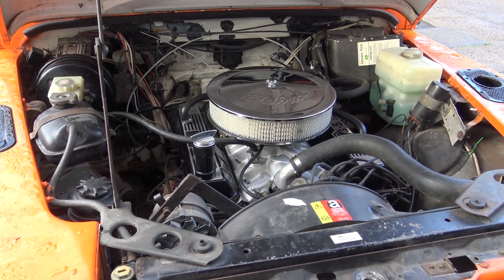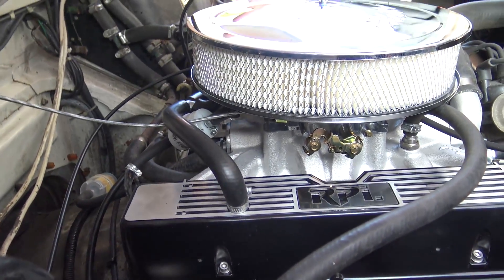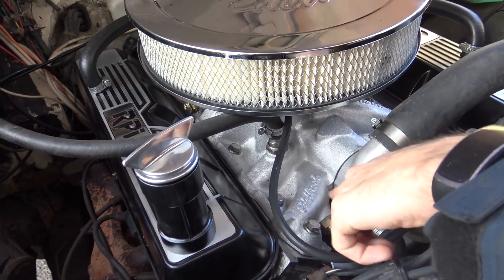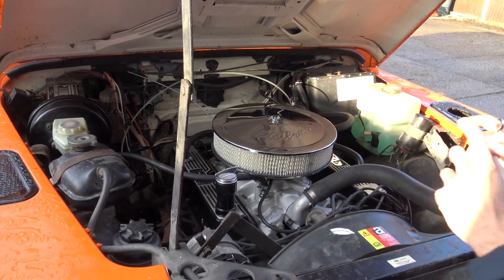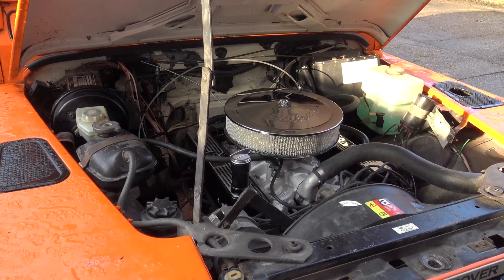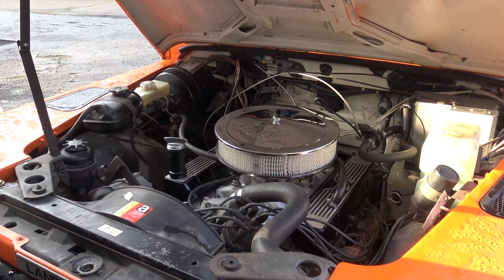Holly's finished off installing the carburettor kit. Both breather pipes from the rocker covers - which he's painted and sanded back so they're looking lovely - go back to a T-piece and into the base of the air cleaner with the little port that's supplied. The PCV valve and one-way vacuum check valve for the brake servo is taken from the original manifold and fitted in, and the original temperature sensor is also fitted in - that's quite important so the gauges still read correctly. Choke cable, throttle cable and fuel pipe with an inline fuel filter are all in. We've just got both mixture screws at one and a half turns out. There's no point doing any settings yet until we've got the ignition system fitted, because spark quality and ignition timing will affect emissions vastly.